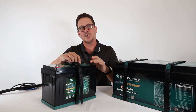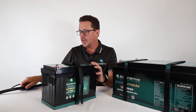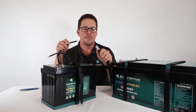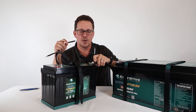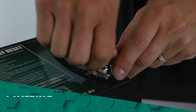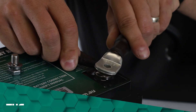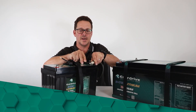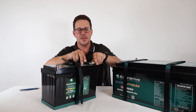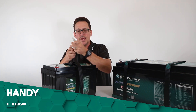We do see a lot of people going to Bunnings and buying larger M8 bolts to stack more conductors on — that's definitely not recommended. If you have more than four negatives or positives, it's always recommended to run them to a bus bar, or to a fuse block on the positive side. Another best practice: you should always layer the cables with the heaviest or highest current draw closest to the battery, then stagger up to the lightest conductor on top. This ensures good contact — if you do it the other way around, the large lug can't sit down properly onto the smaller ones.